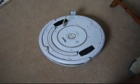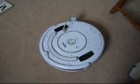There's actually two modes in which we can control it. Safe mode and full control mode. In safe mode, we can tell it all the different commands, but if it detects a cliff, or if its wheels pop out, or if it bumps into something, it'll say, we'll take over here, and it drops out of safe mode into normal mode so that you don't hurt it. If you are perfectly fine with accepting responsibility for driving off a cliff, then you can put it in full control mode, and Roomba will not take over if you do something stupid, which depends on what you define as stupid. You might intend to drop it off a cliff.